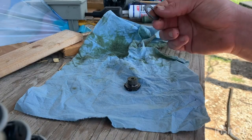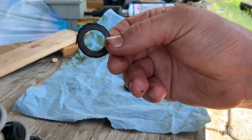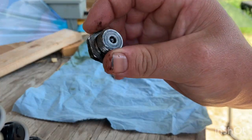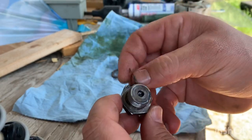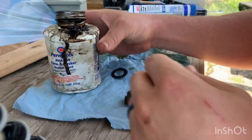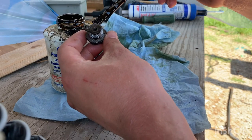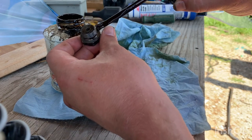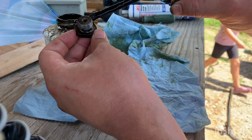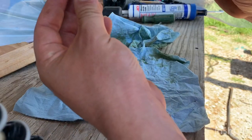Well, I messed up - I didn't think about it, I should have ordered a new gasket for the oil plug and it completely slipped my mind. It's still in decent shape around the edges, but the bolt had big burrs on each corner where somebody had slipped a wrench on it previously. I kind of cleaned those down a little bit. What I like to use is this stuff right here - it's Permatex aviation gasket maker. I'll use just a little bit of this, brushing a little bit on the bolt side and then a little bit on the gasket side, and just let this stuff set up for about five or ten minutes. This stuff works wonders.